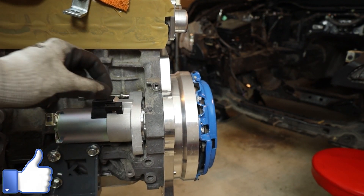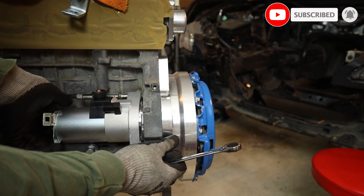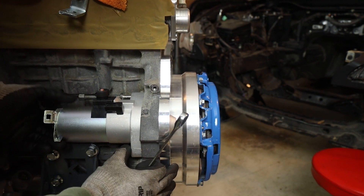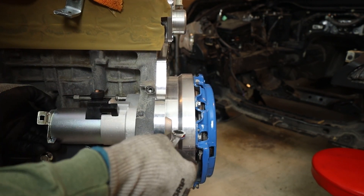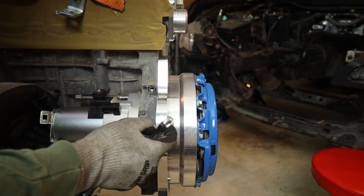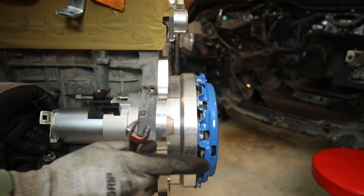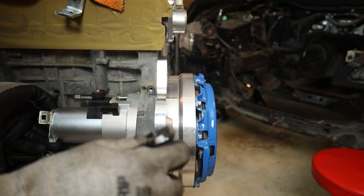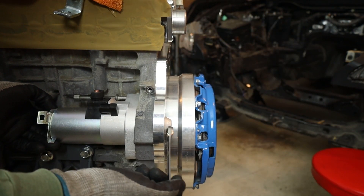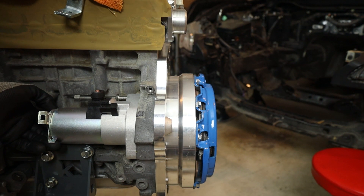The first thing we need to do is measure the tip of this starter motor. When this thing is mounted flush, you can see that the tip of this starter motor actually protrudes outside of this adapter plate. That is a problem because it's going to make contact with the outer mounting surface of our CD009 transmission. So we're going to have to cut our bell housing just a bit to make room. You don't want to cut your starter motor to fit the bell housing because then your starter motor is not going to work.